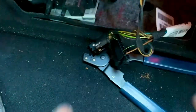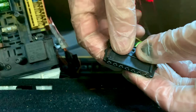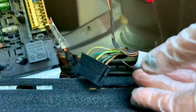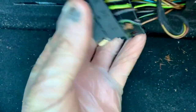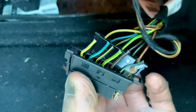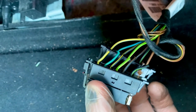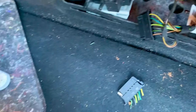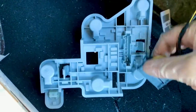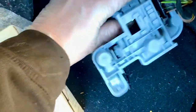Now the same with all the other wires. Once they're all in, we press that cover into place which grips everything a little bit tighter. I've put all seven wires into their correct locations, and hopefully the colour positions match up so when I plug it into the new light unit it should work. Let's get the new light — yes, that's the new one because it hasn't been on fire. The new light unit comes with bulbs and everything, which is quite good.